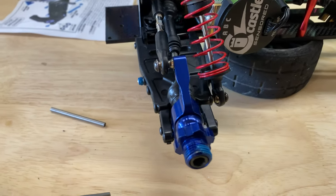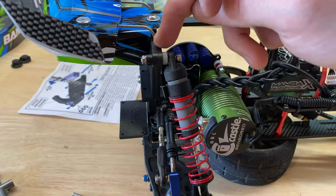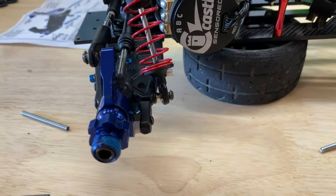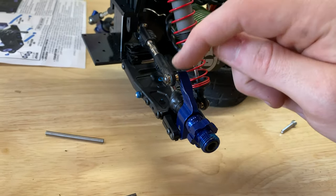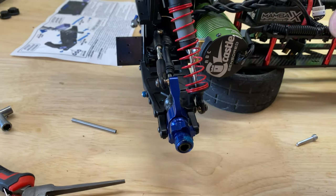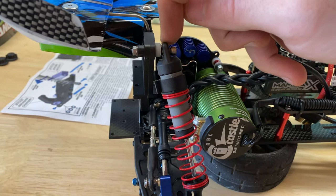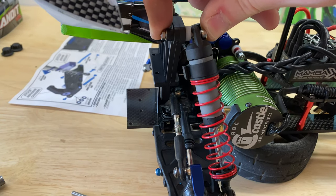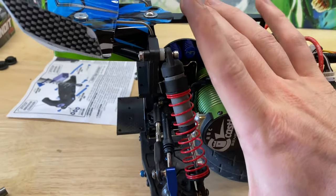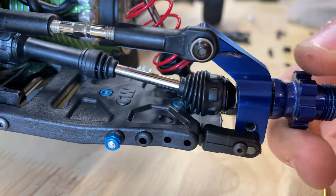Spacers up front move the arm back just a tiny bit. The shock tower mount usually has the shock mounted on one side, and the arms have mounts on both sides, which is great. I moved the shock in front of the rear tire — put a small washer spacer there, a longer screw through the piece, and then a locking washer and nut on the other side so it doesn't back out. Now everything works perfectly with enough clearance throughout the full range.